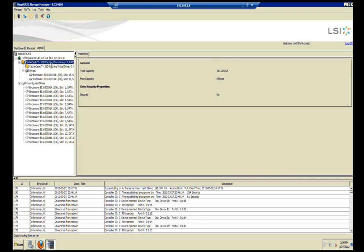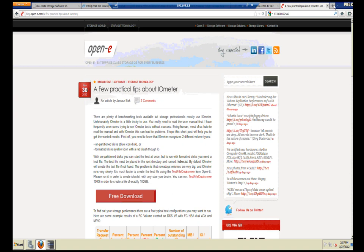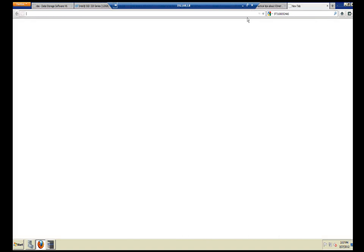Sorry, was there a question? Yeah, I do have a question. Okay. From the audience: does it support a 64 terabyte LUN, and is the cache memory size over 500? Let's talk about that. Let's say somebody does have a 64 terabyte volume. What would be the appropriate size? I guess you would have to evaluate how much data you actually are going to have. Let's say of that 64 terabytes, in a year's time we're going to be focusing on VMDK files or a database file, and that's going to grow maybe 5 terabytes, or it's going to be a pool of 5 terabytes. So for CacheCade, how do you calculate that?